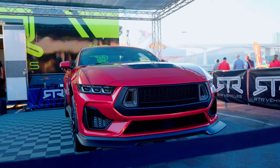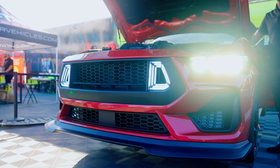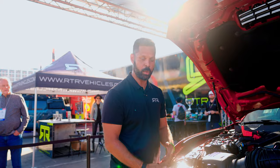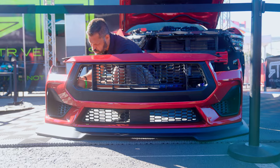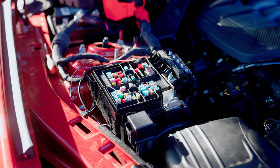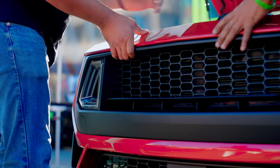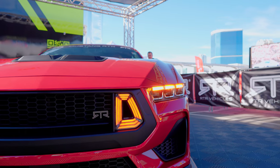What we're doing right now is wiring up our RTR intake LEDs. On the 2015 to 2017 and the 2018 to 2023 models, you'd plug that into the factory harness and then plug that into the back of the headlight so they'd all be one system. People were asking if we could make this a switchback, so we're going to make the people happy — we went ahead and made this into a turn signal as well. Because of the power it draws, we do have to add a fuse to it, so we're adding that into the system right now so we can light up the night.